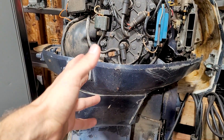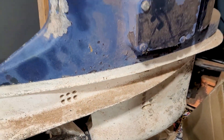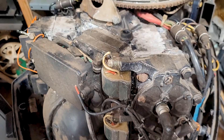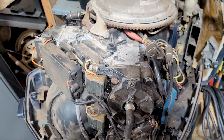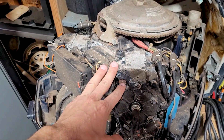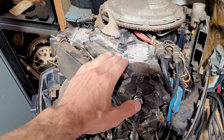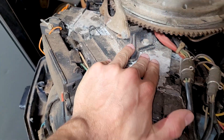Here's something to think about — an outboard. It sucks in water right here from the lake or ocean, comes up, and circulates it through the engine block and through the heads to cool the engine. Even these I hadn't seen as bad of corrosion as those cast iron ones with the rust. They'll get some white aluminum oxide corrosion in there, but nothing as bad as I've seen with these trucks. And this is sucking straight water — no antifreeze — out of the ocean or lake. So what gives?